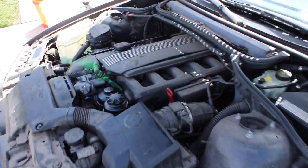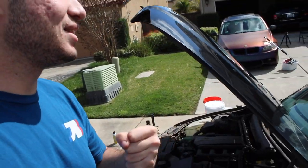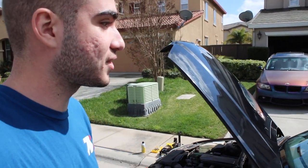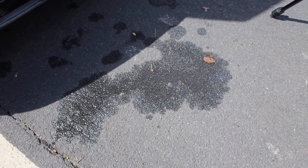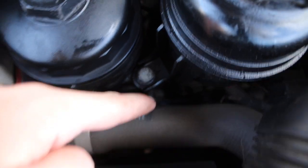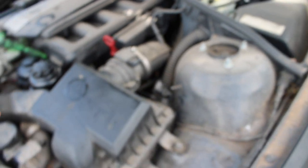So we just put in new oil, drained the old one, put in a new oil filter, and a new battery. We haven't replaced the gas yet, but let's see if it starts. I know the water pump's out but fingers crossed. We turned the key — it almost wants to turn over. When we were starting up the car we noticed a lot of coolant came out. I can see coolant on the serpentine belt. I know that's leaking, but that shouldn't be the startup issue — I think it's the year-and-a-half-old gas.